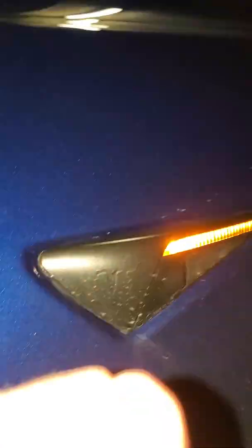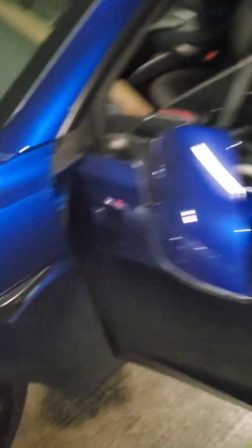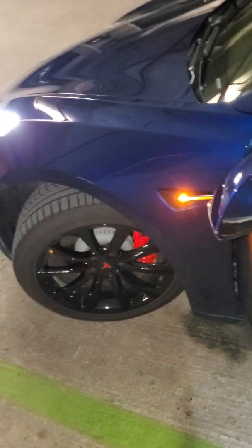My car is a little dirty right now, forgive me. Stick your hand right in and you can get access to this light — it's the first harness closest to the front. Just kind of reach around and pull that out. It's the top wire. It's very obvious — there's a ground wire and a power wire. So you can figure it out pretty easily with a test light.